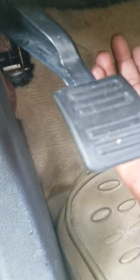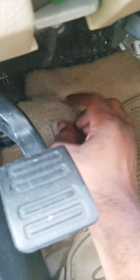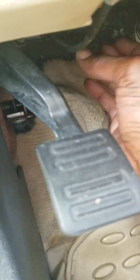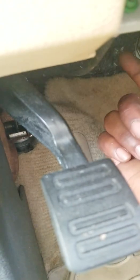All right, like I said, if you do that job to your sunroof, and you still have problems, you definitely want to come and check underneath here. And there's a hose that plugs into the wall. So if you feel upward underneath here, it's a hose that plugs in and it pulls right out. It's probably not in. So if you get a flashlight and look and you still have that leak after you've unclogged your sunroof drain lines, both left and right, driver and passenger, and did your hose pipe check and know that you don't have any leaks on your sunroof, and you're still having leaks right in this area, come up here and dig up high, get your flashlight and see if you see something disconnected. That's probably your problem.